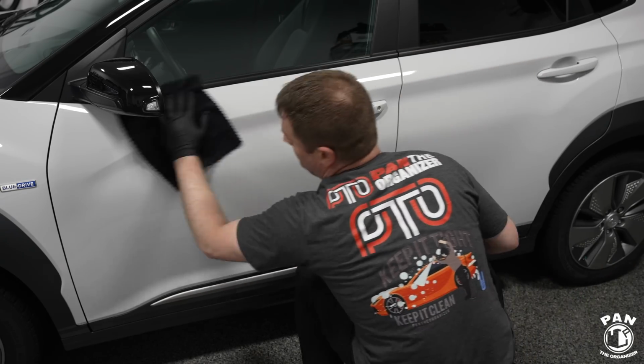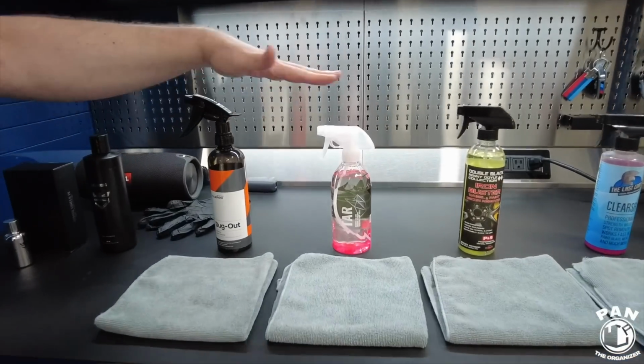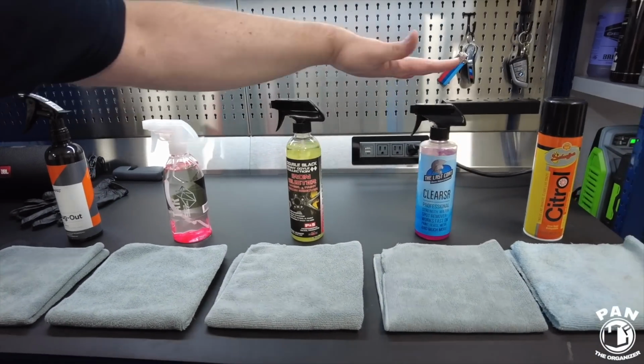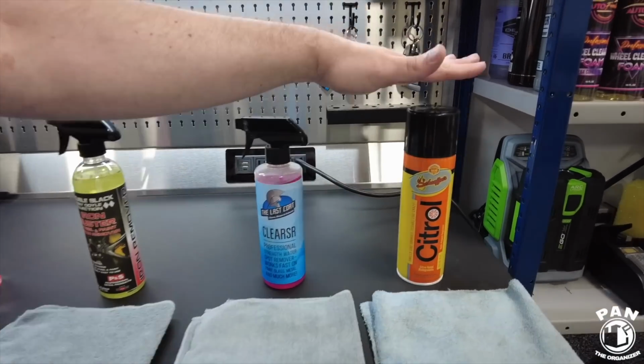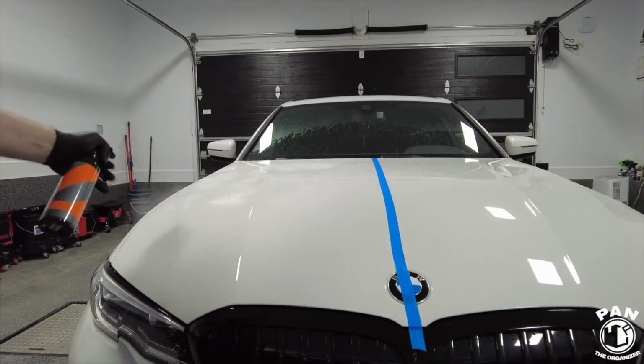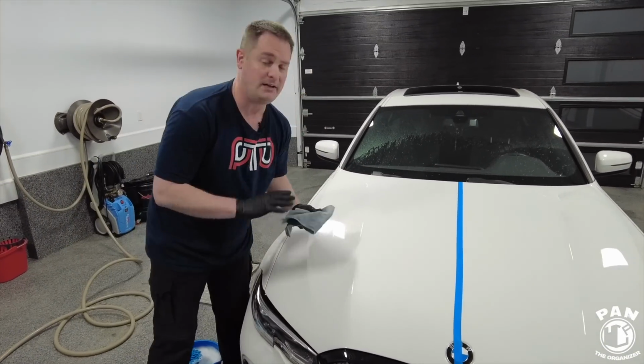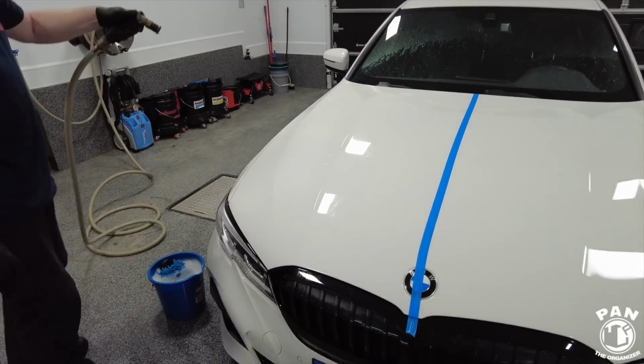It's the ease of application that this one delivers. Absolutely crazy. I also did chemical resistance tests if you want to see all the chemicals that this can resist, even though you would never submit your own paintwork to such an onslaught of different chemicals. It's at least comforting to know that ceramic coatings have a very high resistance to chemicals in the pH range, typically anywhere from pH 3 to pH 11 roughly.